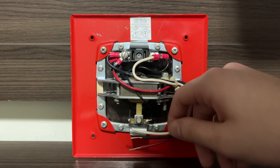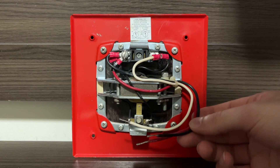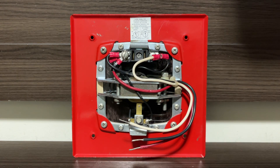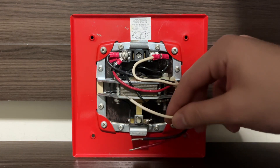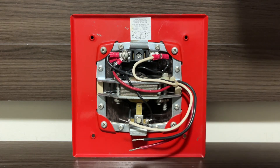You could also use the white and the red, but it really doesn't matter since the black and the red wire, if you look, are actually connected to the same terminal here — so they serve the same purpose. And if you wanted to wire this horn up for DC, you would use your white as your negative and then either your red or your black as your positive, going off of the diagrams on the top.